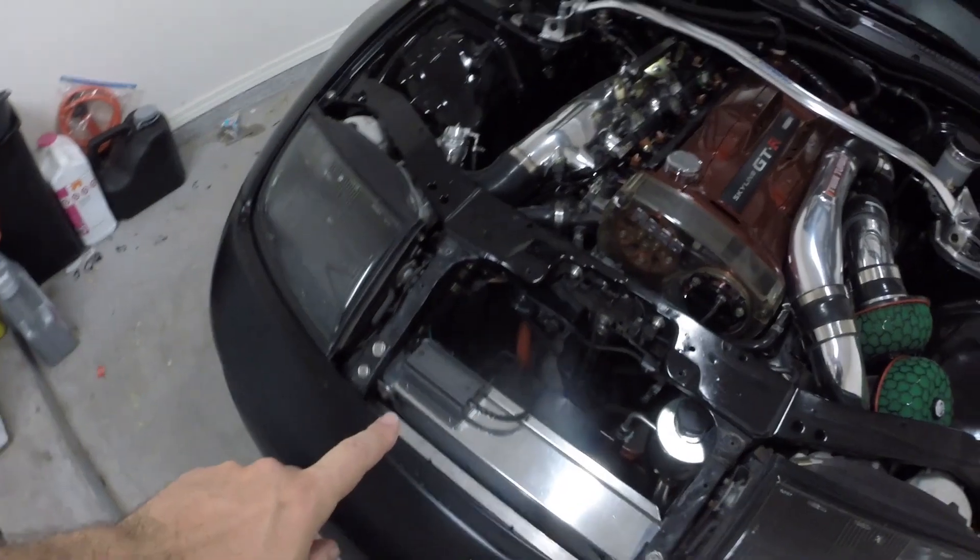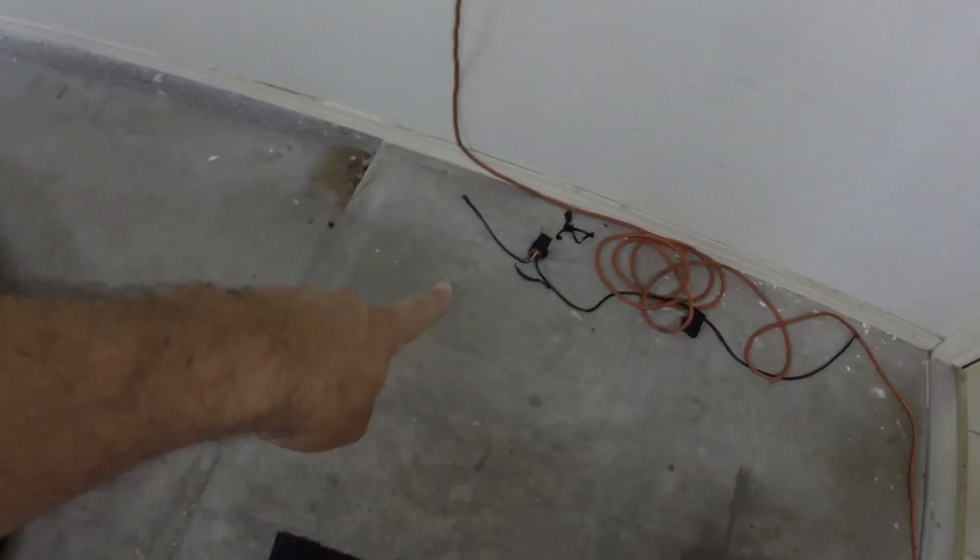Just a little video after the video — I was cooking some lunch on the phone with my dad. He was asking me if I've gotten the issues with my RB sorted out. I told him I got the fan controller in and it's freaking amazing, but I'm having this issue with it staying on after shutdown. And then it was like a light bulb came on in my head — instantly I figured out exactly what I'm going to do. Once the ignition is turned off, it's easy: it's a simple relay. I'm going to put that relay back on the main ignition circuit so when the key is shut off, it will close the relay and no more power will come from the battery, and the fan will just turn off. Too easy.